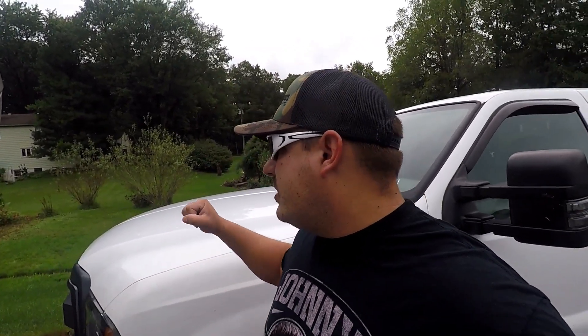On top of that mistake, I later found another one. I went ahead and replaced the high pressure oil pump — I wanted to make sure everything was good before vacation. The last thing I needed was a breakdown 500 miles from home; our trip to South Carolina was about 600 miles. I picked the CNC Fabrication Stage 1 high pressure oil pump — love it, it's running great. When I took the high pressure oil pump cover off, I also found that when I did my IPR valve I had actually messed up the o-ring that sits on top of it.